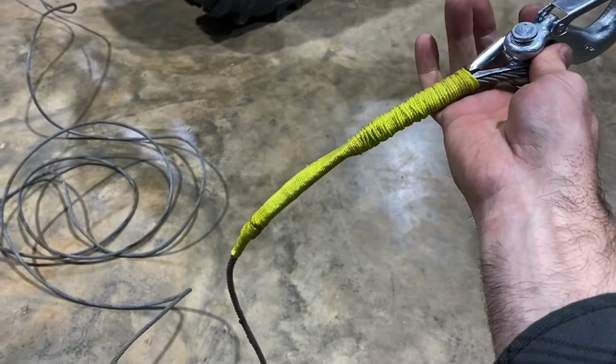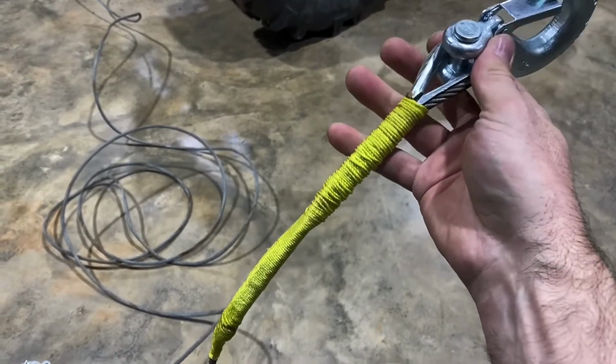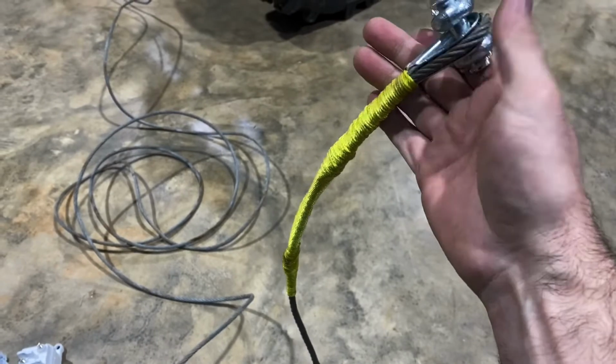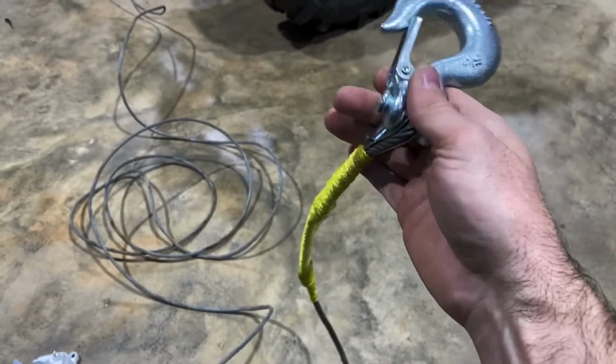And you'll see on YouTube, there might be tutorials of people showing you how to repair these winches or whatever, and they use these clamps, these saddle clamps, and that's a really bad idea. They're not great. The screws can hook on things and break, and then you're blown up if that happens. They'll cut your skin, cut your gloves. They're terrible, so don't do that.